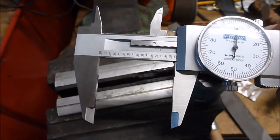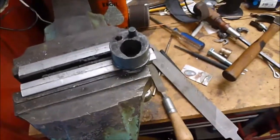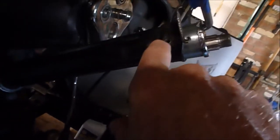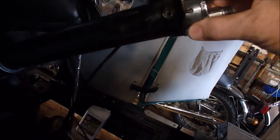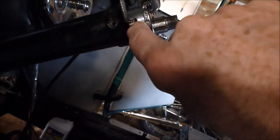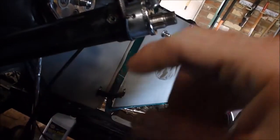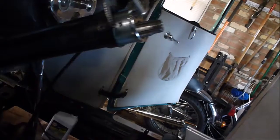I had to drill new holes, which I did with the located assembly technique. Once I got the bushing in there and dropped it in, I just found the holes located off of these. It's a 10-32 screw, and I needed to make a bottoming tap for that. I got the tap started, then I just bought an extra tap and I'll cut the end of it off with the Dremel cutoff wheel. I'll square off the end of another 10-32 tap and I'll be able to get the threads right down to the bottom.